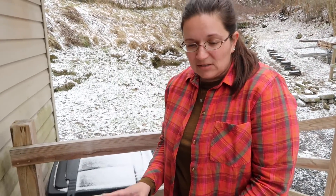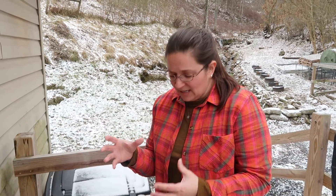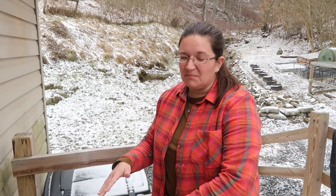I have a heater right now that's about to go through the dry burn process. We're doing it outside because dry burning burns off all of the carbon deposits, tar deposits, and gunky buildup on your wick — and it emits all kinds of fumes and a really nasty smell that you don't want to breathe in. The manufacturer's instructions actually specify that you should dry burn outside.